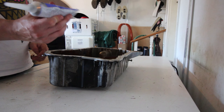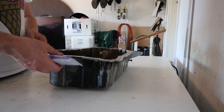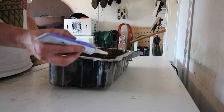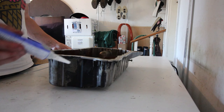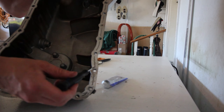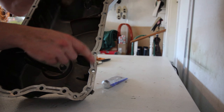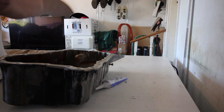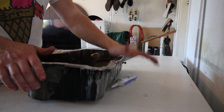I've got my Permatex Ultra Synthetic oil pan gasket maker here. The big thing with doing the oil pan gasket is you want to make sure - especially at the bolt holes - that you go on the inside of the bolt holes, not the outside, because if you go on the outside it'll just leak through. With the VR6 oil pan it has these little galleys for the gasket maker - you have to make sure you get it in there as well. Other than that it's pretty straightforward. I also cleaned out the inside of the pan of any carbon to give things a bit of a refresh.